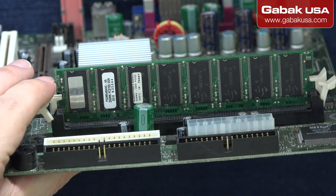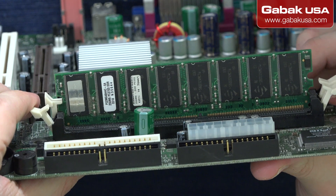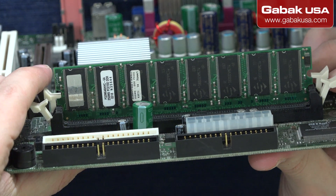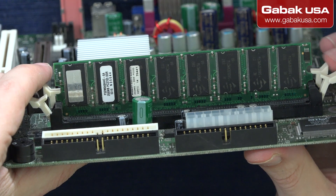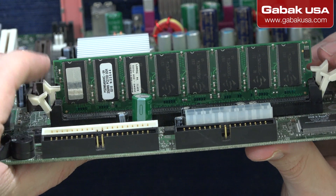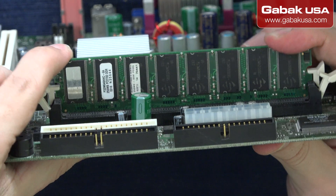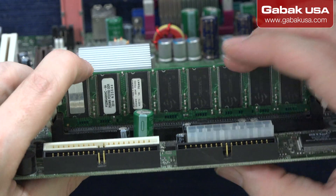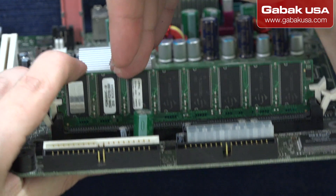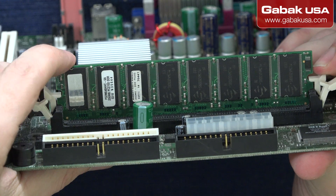Make sure that if you have the right RAM, as in this case, it's all the way in. I've seen this kind of mistake where maybe the RAM is not all the way in. You see the locking mechanism is not all the way in - and the computer will not work or it will not detect all the RAM properly. So make sure it's all the way. Just push - don't worry, you are not going to break it. If you push it upright like that, this RAM is very hard and you will not be able to damage it that way.